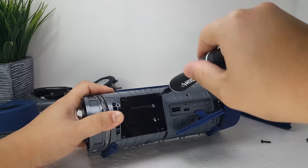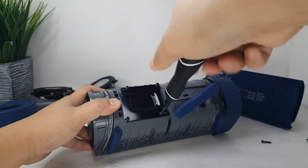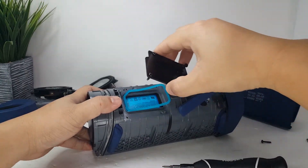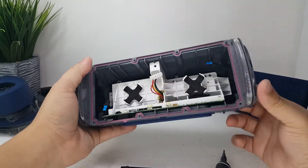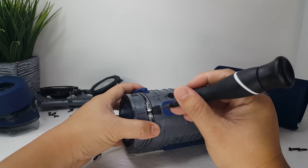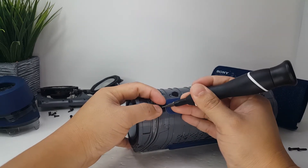This plate is held on by four screws. Once it is removed, you will see this nice rubber seal that helps prevent water from getting into the speaker. Before we can remove the internal frame, there are also three hidden screws on the body of the speaker that will need to be removed — secretly covered up by these black sticker foam.